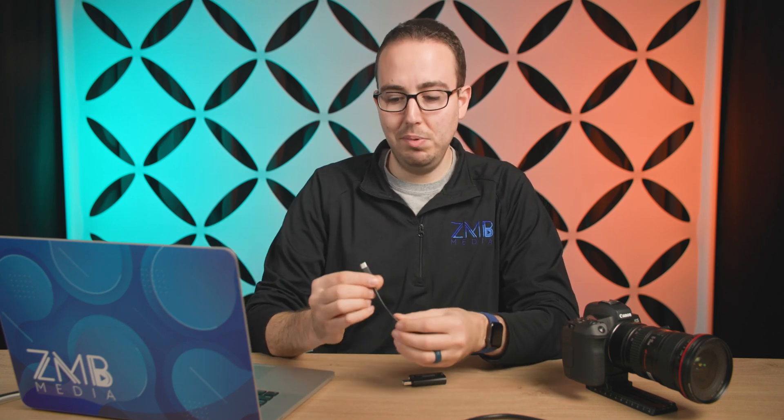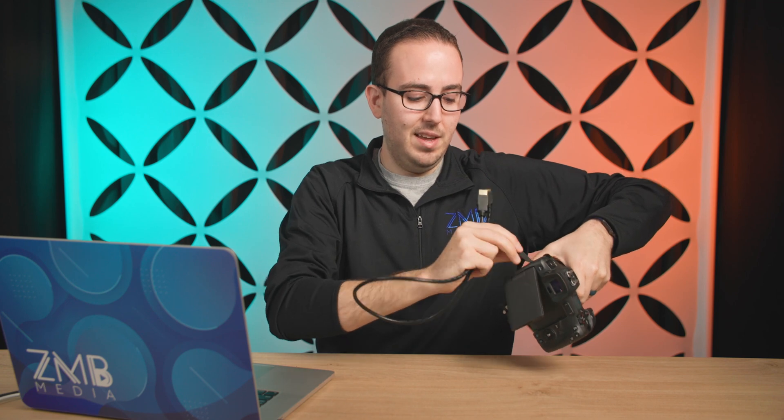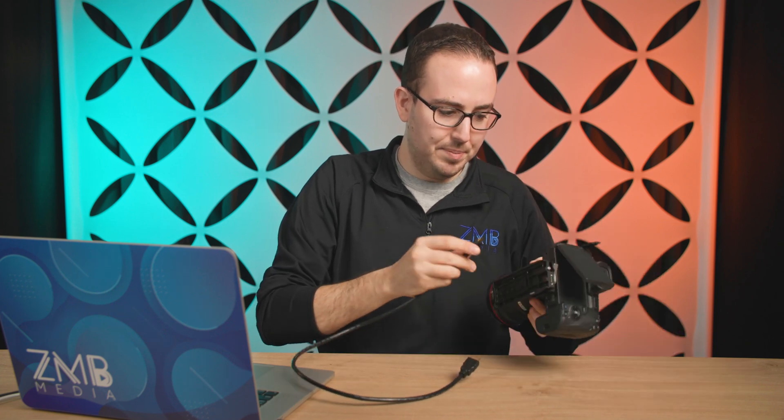For this MacBook Pro, it has USB-C plugs, so today I have a USB-C to regular USB 3.0 adapter. I'm going to plug that in and then plug our capture card right into the adapter. With this particular camera — the Canon EOS R — this has a mini HDMI, and this is a big mistake a lot of people make: not all cameras have a full-size HDMI. You need to make sure you're getting the right one. This cable is a mini HDMI to full-size HDMI, so I'm going to take this into our camera and output it to our capture card.